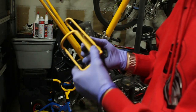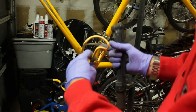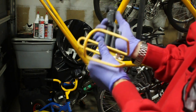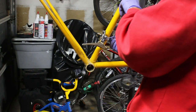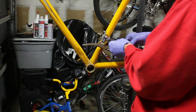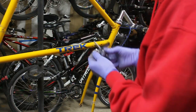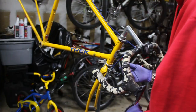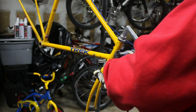It looks like somebody actually painted this at one time because the paint is not sticking to the aluminum too well. It's also a little crooked — it looks like the previous owner wanted their bike pump here and had to twist it sideways. The basic teardown process is to remove all the existing components: wheels, crank, seat post, handlebars, brake levers, brakes, front and rear derailleurs, shift levers, stem, headset, fork, bottom bracket, cables, cable housing, cable guide, and finally the seat post retaining bolt.